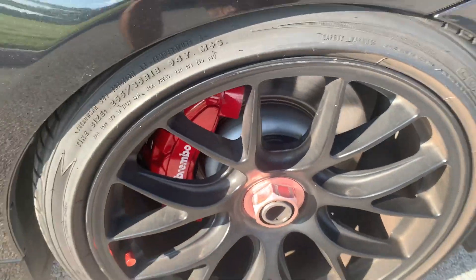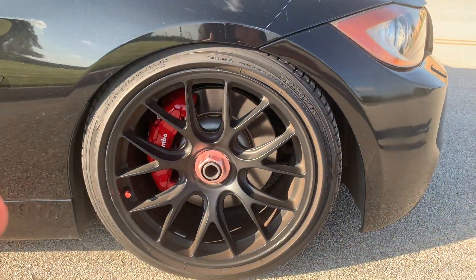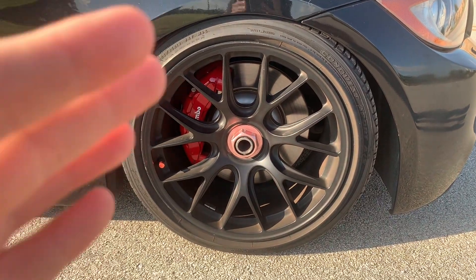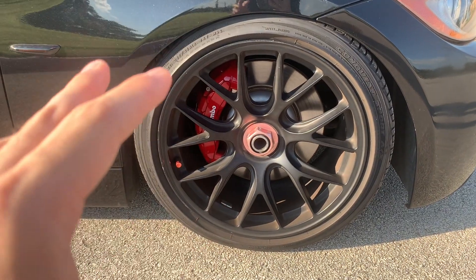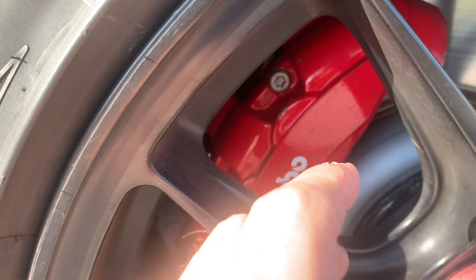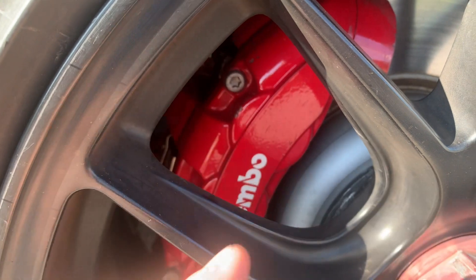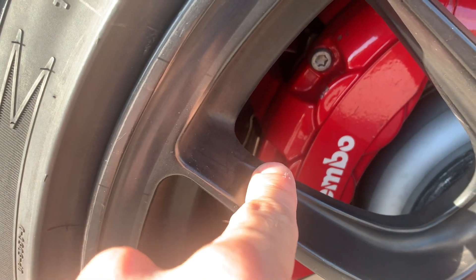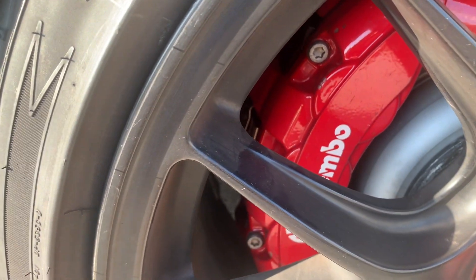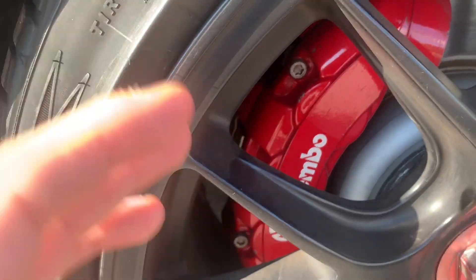As you can see, I have a blank rotor on here. For the actual brake hardware, for both left and right I bought four brand new brake pad screws because the old ones were a little stripped. I like having all nice hardware. The clips were still in good condition — they just had a lot of brake dust on them — so I sandblasted, cleaned, and wire brushed them and they're good to go.